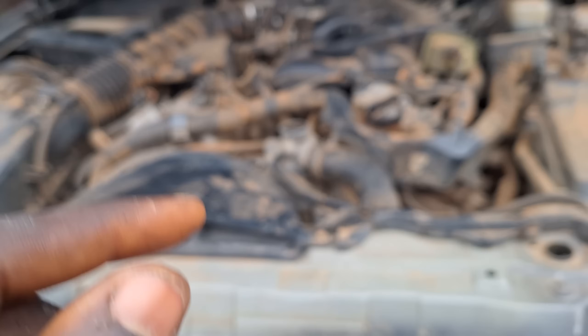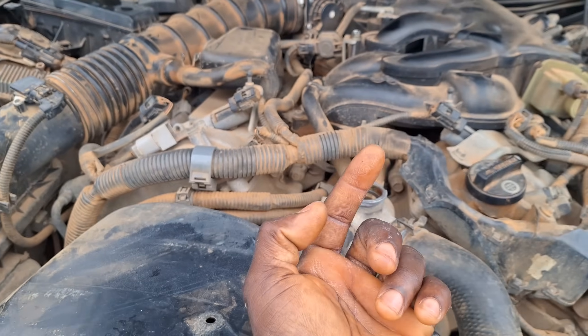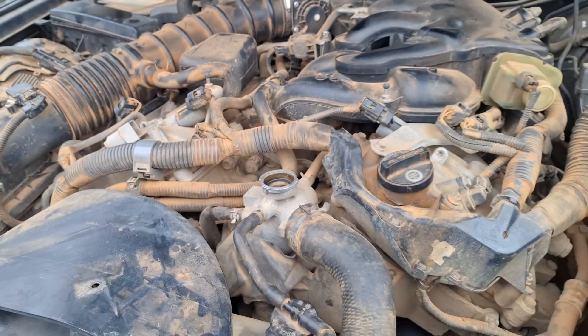The car was also misfiring on one cylinder, and that's a sign that that cylinder is the one losing compression — water is getting into the cylinder. I'm going to start up this car; you'll see that water will pump out here as a result of compression from inside the engine getting into the cooling system.